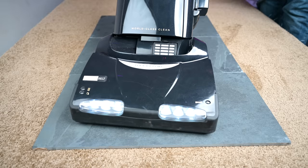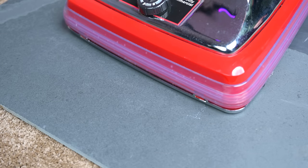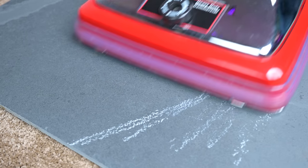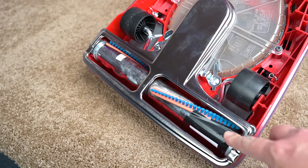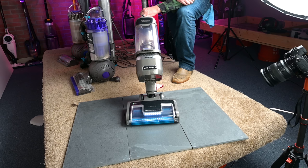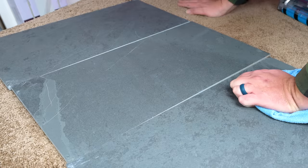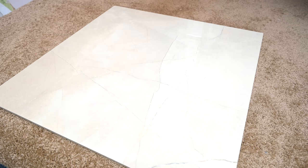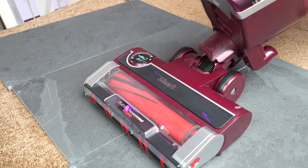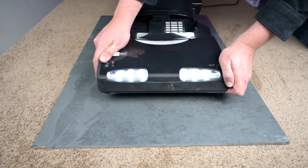In these tests, I found that even on natural stone tile, I could not make a scratch with any of these vacuums, except with the Sanitaire Tradition — and that was only because on its lowest setting, the metal on the base plate scratched the natural floor type. But that vacuum is explicitly not supposed to be used on hard floors anyway, and certainly not on its lowest setting, so it wasn't really fair. There was one anomaly with the Shark LA502 Rotator, one of Shark's cheaper Duo Clean designs. I found that on the natural stone, it did leave a mark if I kept it in the same spot for a while — I'm not sure I would call it a scratch, but it definitely was a mark. It did not do this on the other tiles, just the natural stone one, and all the other Shark Duo Cleans I tested on natural stone did not leave a mark, so I think it may have been a rare case with that particular model. To sum up the scratch test results: I could not find a link between aggressive brush rollers and scratches on tile floors.